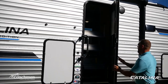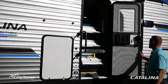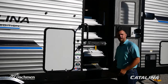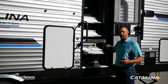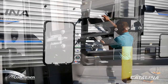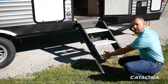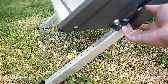We use a friction hinge on our entrance doors, which adds a lot of resistance so they don't swing loosely. For the entrance steps, we've gone standard with fold-down solid entry stairs at the main entrance — real sturdy, with a wide platform up top. To bring them down, move the lever to unlatch from the doorway. You can also adjust the leg height using a simple pin — pop it out, slide the leg, and pop it back where you need it.